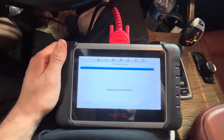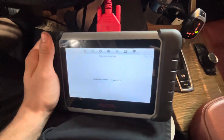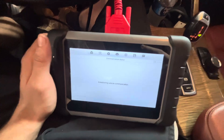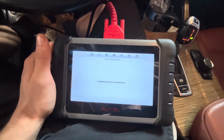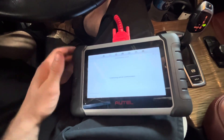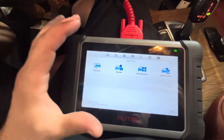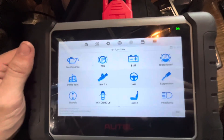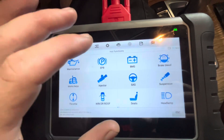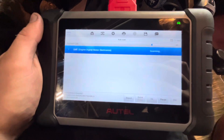We're gonna go ahead and scan this — this is my little Autel scanner, I got this on Amazon for about 300 bucks when they had it on sale. I'll put a link in the description if you guys want to get one, because on any modern vehicle you're pretty much going to be required to use a scan tool. If it's got a misfire you gotta figure out what cylinder; if you need to do the brakes sometimes you gotta retract the electronic parking brake. This thing pretty much has all the functions you need for damn near anything. You got hot functions right here: oil resets, electronic parking brake, replace the battery so the alternator doesn't overcharge the new one — a whole bunch of stuff you could do in here.